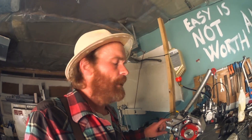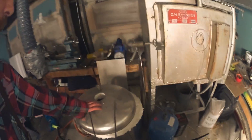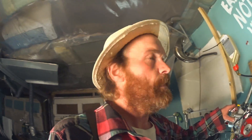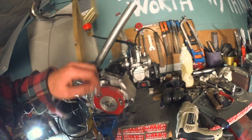The head is not final — I've got another idea for the head: different combustion chamber, different squish, different cooling. Cooling is not optimal in this cylinder; might not be needed on methanol and nitromethane, but I had to do it this way to be able to cast it myself. I cast this cylinder myself in my garage. Here's the burnout oven for the PLA in my lost-PLA process, and here's my casting oven. I plated the bore — there's my plating setup. I used the wrong kind of boron nitride; it's a nickel boron nitride composite plating — used the wrong kind, too soft. Now I've mixed in a lot of silicon carbide powder.